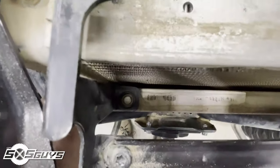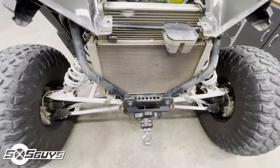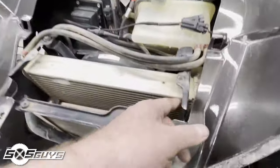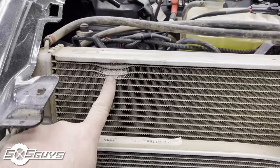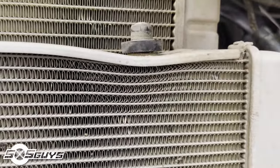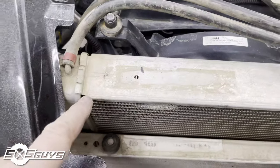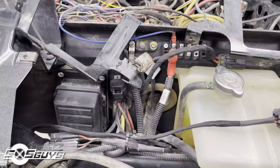Pulling that bracket back out would separate the intercooler from the front radiator and realign the hood correctly. Unfortunately that means taking more stuff off, but if I do that, I think we'll be back in action straight as an arrow. I noticed something squishy that I missed before — I'll keep an eye on that one to make sure it doesn't start leaking. I got the brackets all straightened out; they just pull right out. The brackets are straight, going back in, and then I've got some wiring to clean up.